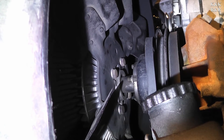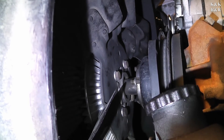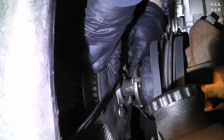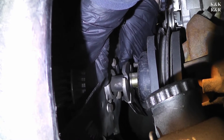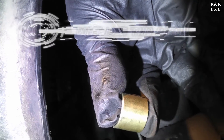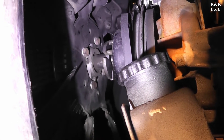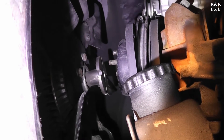Make sure that ahead of time you loosen up your fan blade cover for better access. Then you should just be able to pull your fan blade and fan clutch off — the lock washers will drop, that's why you have cardboard or you're on concrete. Don't forget if your truck has a sleeve, take the sleeve out — this is a sleeve for the aftermarket fan clutch. You should just be able to wiggle it out without damaging the radiator, or just pull it out with the fan blade cover.